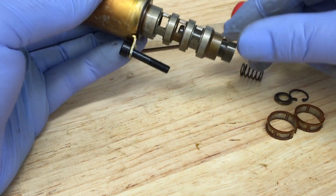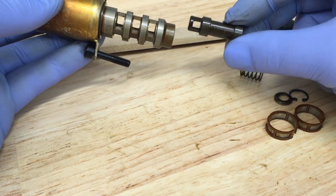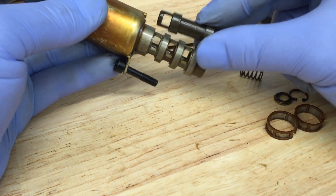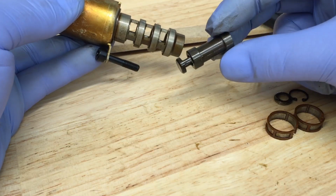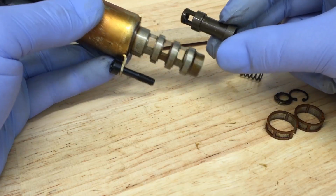So this is the valve that's inside of there and has lands on it, just like a valve in a transmission valve body, and they seal off the oil that's flowing through it, and they move throughout the bore on there, and they open or close passages. Now, in a transmission, the fluid has a lot of additives to it, so it's always cleaning the valves, and they can move back and forth freely in there for a long time. Usually it's not an issue.